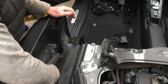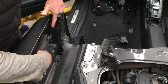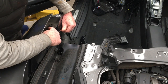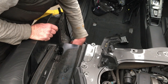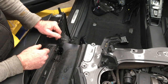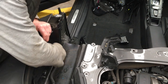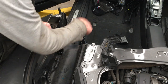The problem is that if the drain gets clogged and it overflows - if this one here gets clogged - it's going to flow out the back. Whilst some of it will go into the bucket, that bucket isn't perfectly sealed. So what happens is it actually comes out near the seatbelt area and goes underneath the floor of the car, filling up where the rear BCM is and the amplifier on the right hand side - which is bad. Similarly if the front one overflows because it's all clogged up, it's going to overflow over the front and go to the same place. So clearly keeping these things clean is key.